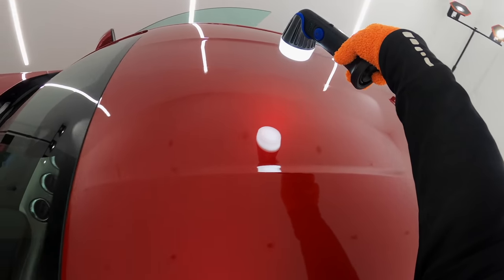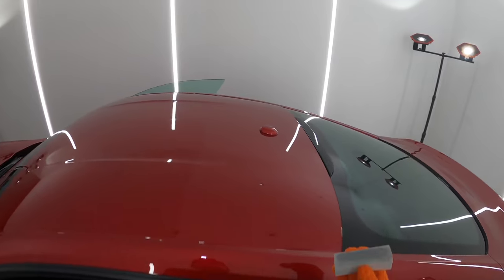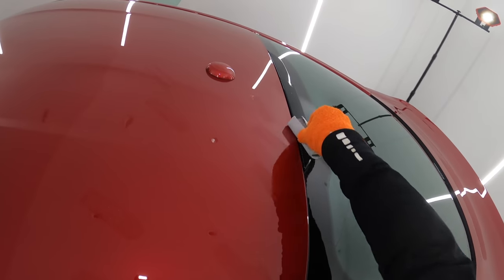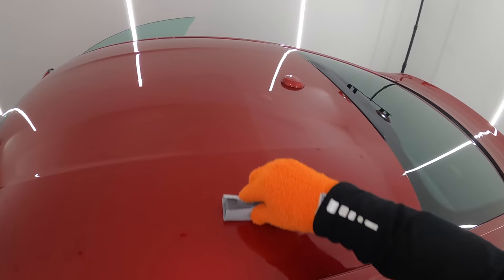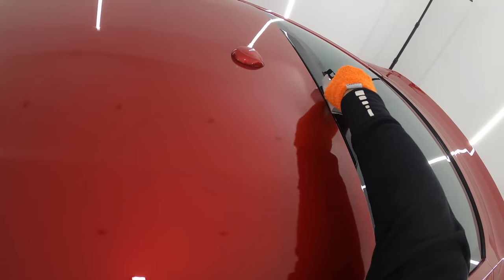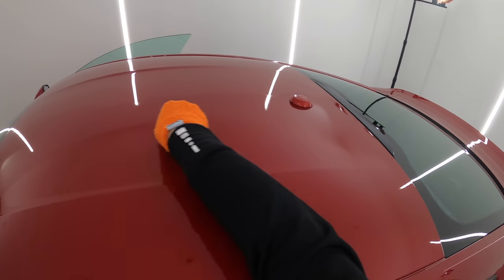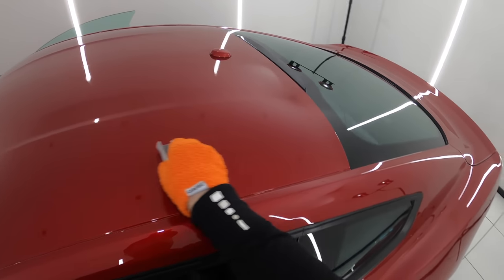But with most other coatings, including Nova Pro, you'll need to look at it and wait till you see it start to dissipate and streak on the panel, and then you'll have to assess how it feels while you're wiping it down. If the coating starts to smear and just feels greasy while you're wiping it, that's a clear sign that you haven't waited long enough and that the coating hasn't yet effectively bonded to the surface. But if the coating feels overly grippy and difficult to wipe down, then that's a sign you've waited too long before leveling it down. The coating should wipe down cleanly without smearing too much, and it also shouldn't be too sticky so that you need to use force to remove the excess, all of which is a good sign that your wipe down time is correct.